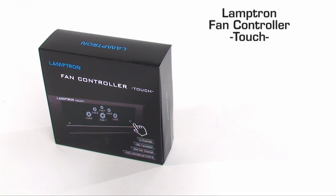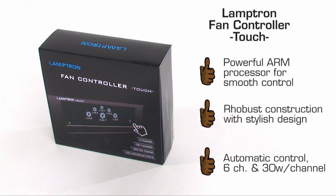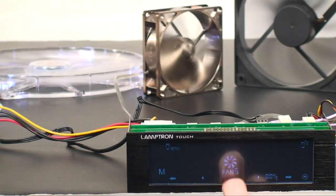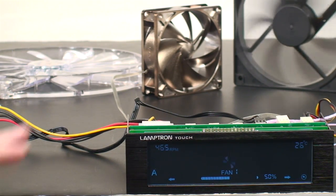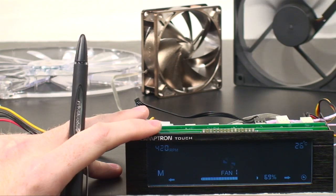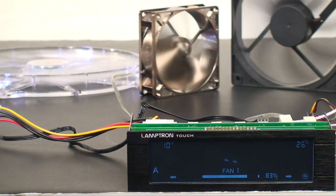And that is the Lamptron Fan Controller Touch. There's no getting around the fact that at $70 it's a pretty hefty investment for a fan controller, but for your money you are getting one of the more powerful and intuitive devices on the market. It's constructed very well and features like six channels with 30-watt outputs definitely justify the price. Unfortunately the key aspect of the device was also where it had its one strike against it — while the touchscreen was amazingly quick and very responsive, it could have used a little more refinement. Because the controller uses a small screen, it has relatively small function buttons, and I found it difficult to make adjustments, often having to repeat my actions a few times to pull up the right fan or adjust speeds. Then again, once you have automatic mode set up, everything becomes very hands-off.